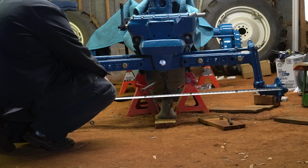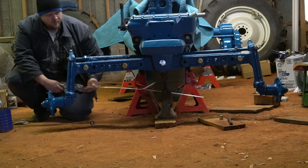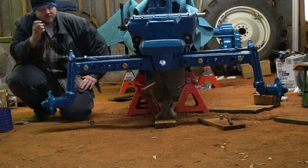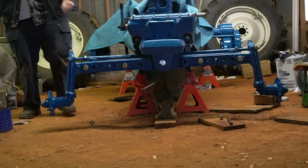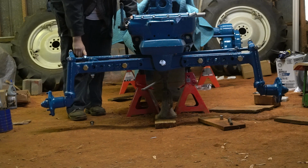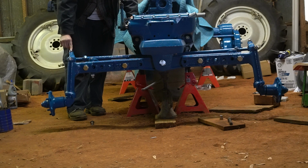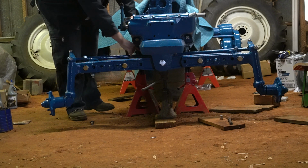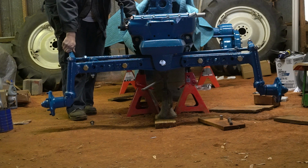61 and 5/8 and 61 and 7/8. So that's 1/4 inch of toe in as it sets right now without the wheels. So I'm going to leave it at that. Your clamps, tighten them down to about 20 foot-pounds. Your castle nut, lock nut on your joint, on both ball joints, the manual calls for 90 to 130. Good luck getting that without an impact.